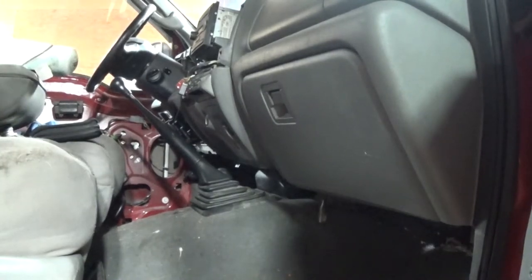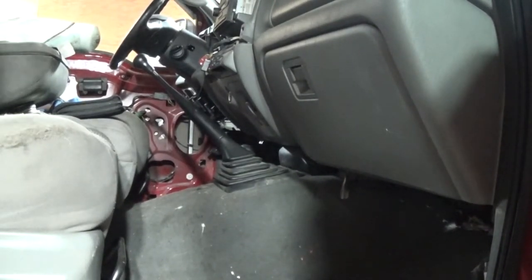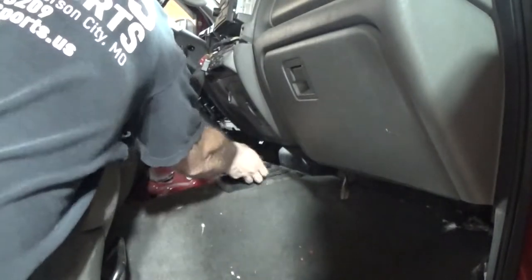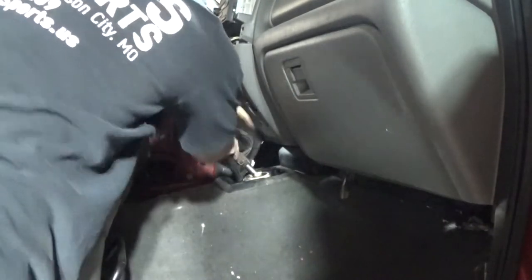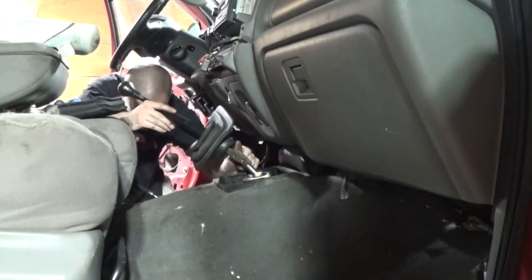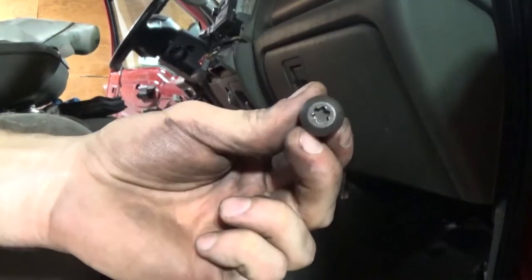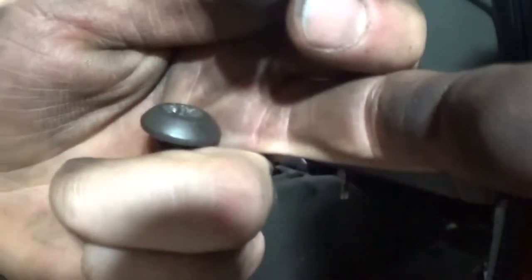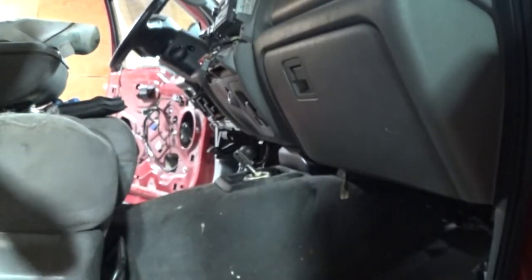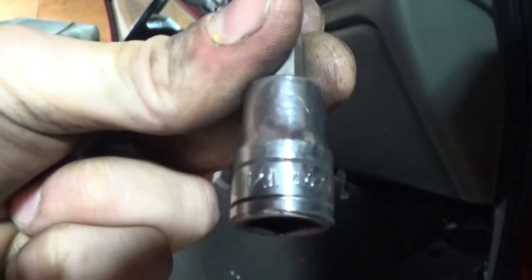One thing I've got to do is get the shifters out — actually both shifters. We'll start with the transmission, then the transfer case. The transmission ones are never fun; they're a pain to get to. Some of the screws — this one's loose already, so we don't need to do that. This one's not so bad, it's got two bolts. Sometimes they have a jam nut. Those usually get beat up pretty good — somebody's had them off before. I end up using a T40 Torx — got it off.